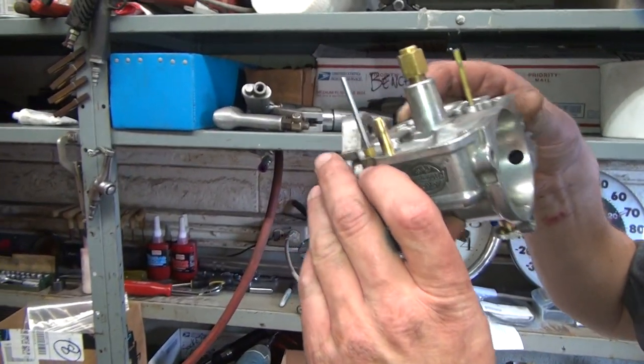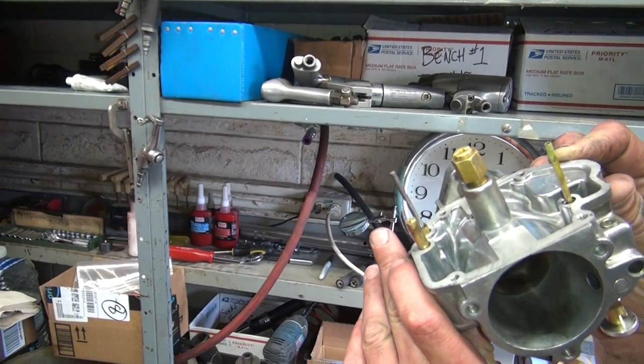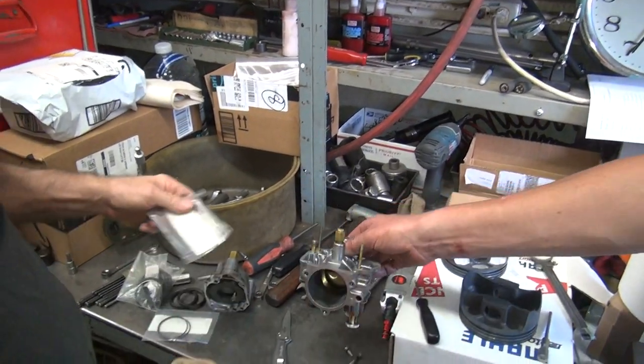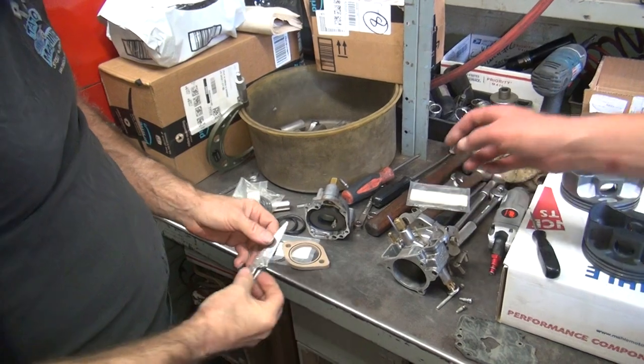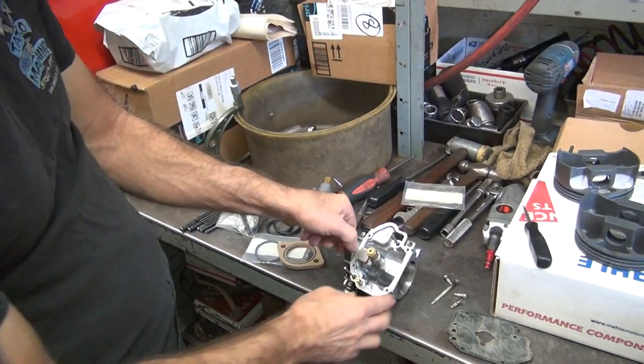You guys move this thing way too much. Okay so you've got a 0.0625 — 0.265, yeah. Why is it so lean? That's what it was. Well, it's to save on gas. No wonder it doesn't run off the choke — that's lean. I want to save on gas.